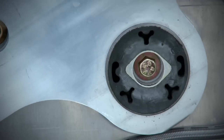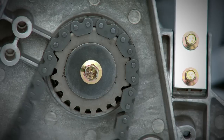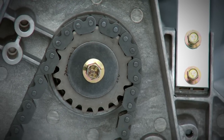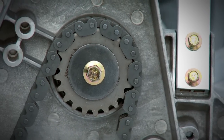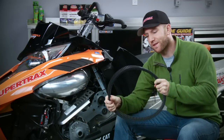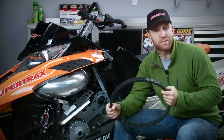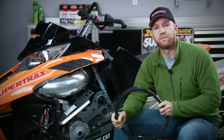Key to the design is the rubber mount on both the motor and jackshaft end of the TCL, allowing the motor to move in harmony with the jackshaft and isolating vibrations. While it is normal for a belt to change shape during the clutching process, it's the side-to-side bending of the belt that significantly reduces its life, robs horsepower, and reduces efficiency.